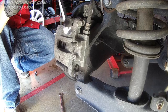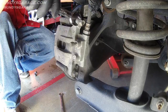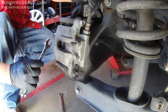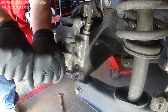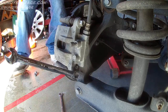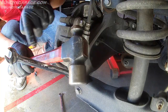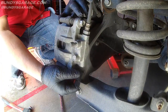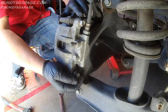Put this on here and press down. The key thing to remember is that you need to grease these pins — the brake caliper slides on the pins and you need to grease those. Sometimes you need a little help getting them loose, so I have a hammer here to hit the wrench. I'm only going to do the driver side since the passenger side will be exactly the same.